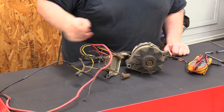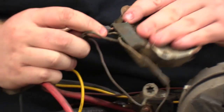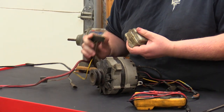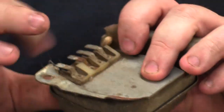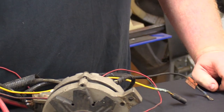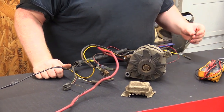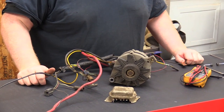This is the entire charging system out of the truck — we just unbolted everything. As you can see, friends have scotch-locked all kinds of wires. These terminals are really corroded, which is going to drop your amperage across the pins. There are cut wires in here, a fusible link with something gigantic taped to it — that's probably not good. Old damaged wiring is where a headlight comes in for testing. If you think you have bad wiring, load test the harness by running the headlight through the wire — if it pulls the amp load, the wire is fine; if it doesn't, the wire is bad.